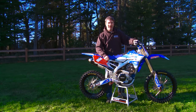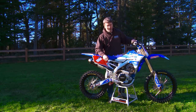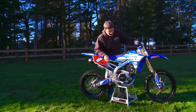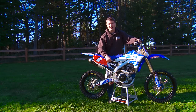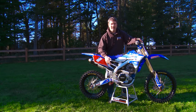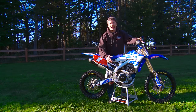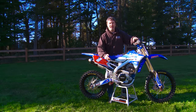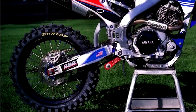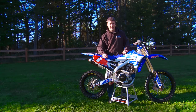The motor we use is Yamaha's TTR-125 motor that they've had for years. They're great bone stock, but we pump them up — we did the BBR 150 kit and the BBR cam. This was an electric start model and originally we were going to take all that stuff off to make it lighter, but we realized we could take the kickstarter shaft, all the gears, shrink the wiring harness, and get rid of the kickstarter. It ends up being lighter just as an electric start with one of the super lightweight batteries, and it ended up being better that way.